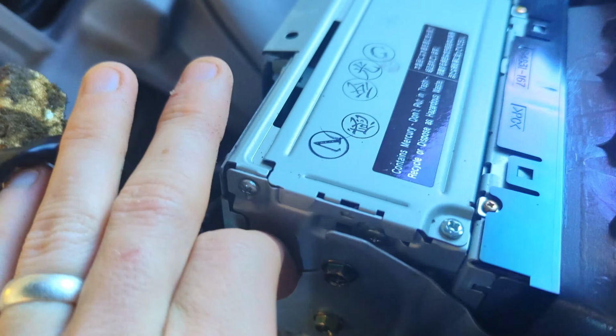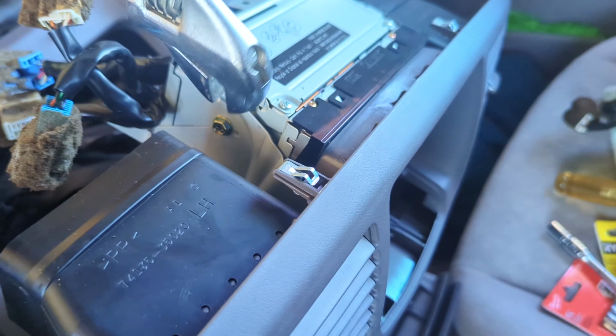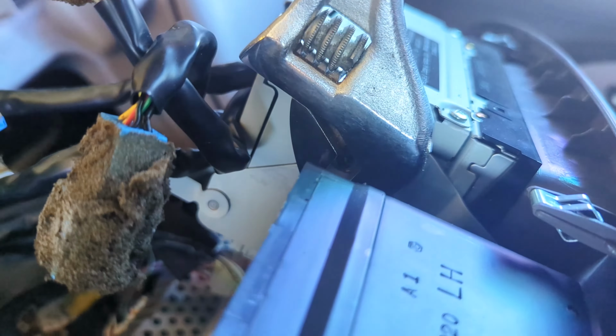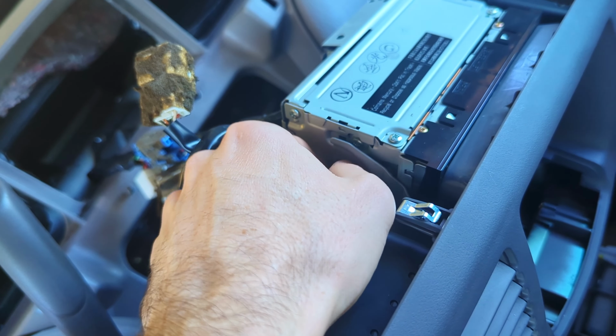And then we're going to take out these four screws. Well, they're bolts. 1, 2, 3, 1, 2, 3, 4. And to get those out, these are in the way. Instead of removing those, we're just going to use a different tool. You could get away with a crescent wrench, an adjustable spanner. You adjust it to that bolt's sides, and then you turn lefty-loosey. Once it's loose enough, you just go by fingers and it comes out. It's just that initial breaking of the tightness that's difficult.